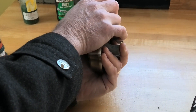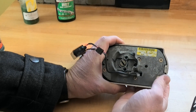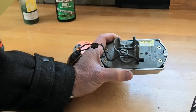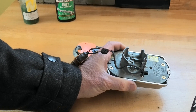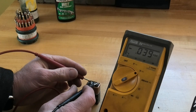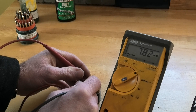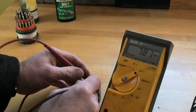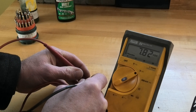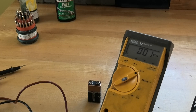So now I'm going to put in the code — you can hear it click and I know it's working because the pin back here spins. Watch this slot — I'm going to do the lock mechanism and you can see that's moving back and forth, so it's working. I'm going to reinstall it, leave it out in the cold, and I'm guessing that'll take care of the problem. Now that I've got it all back together — this isn't the first time I've done this — it could just be the battery. I'm testing and only getting 7.8 volts; if there's not enough power to push that actuator, the solenoid, down then it wouldn't engage that cog. I'd try just replacing the battery first before you take it all apart — but now you know what it looks like inside.